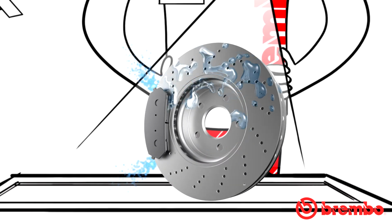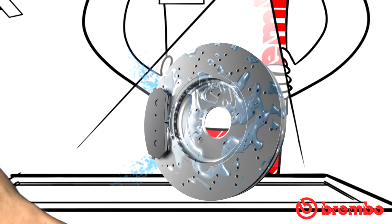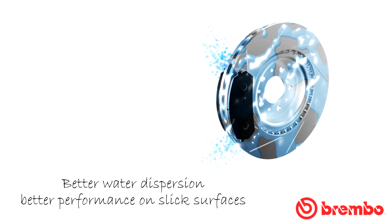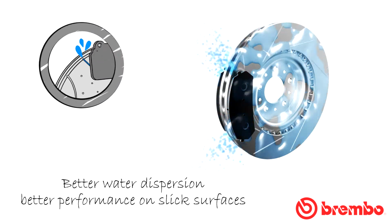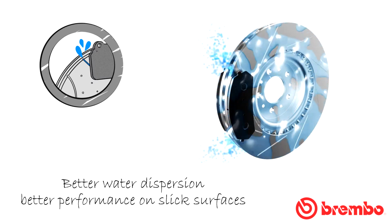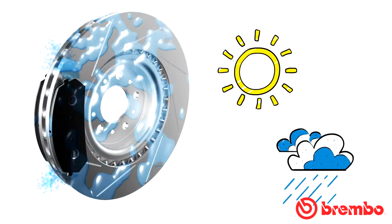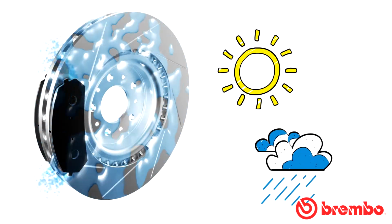Holes also help break up the film of water that may form on the braking surface. For this reason, even when driving in wet conditions, the brake system responds efficiently right from the first brake. In the same way, the grooves facing outwards also help ensure more effective dispersion of any water that may be present on the surface of the disc, with benefits in terms of uniform performance in all weather conditions.